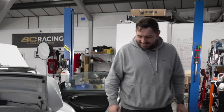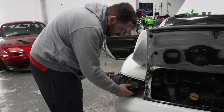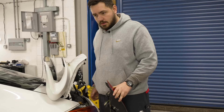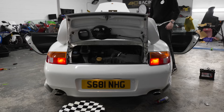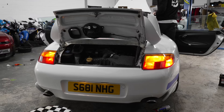Another thing ticked off the list. Just got to work out our side light, which we think is just a bulb. Unfortunately we spoke too soon — one brand new bulb later and we still didn't have all of our rear lights. The brake lights are on but the side light doesn't work on that side. We tested it and when we put this one on that side, no side light but we did have a brake. Sure that it was a deeper issue in the car's wiring, we spent more time consulting the wiring diagrams. And then the side lights are on. Brake — the braking commences. We're going to come in with this and the MOT man's going to go, boys, you shouldn't have. That's all the lights. As Kanye West would say.